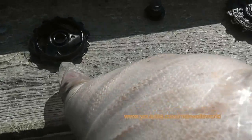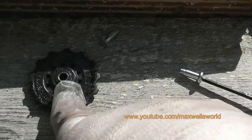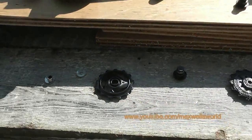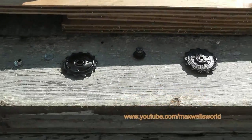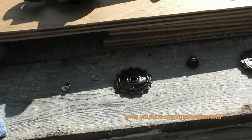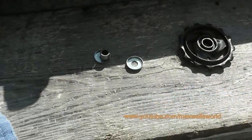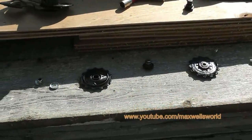When putting the chain through, note that this replacement cog has little end caps and an external bushing, whereas the original has the bushing pressed inside without end caps. That reflects a slight difference in derailleur level — the original is a bit better. When changing it, don't lose any of those little plastic or metal spacers or shims, because without them it won't function correctly.